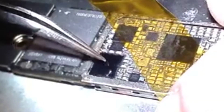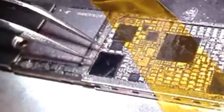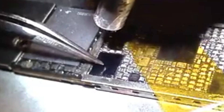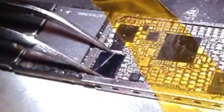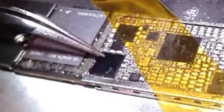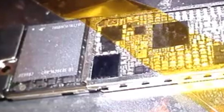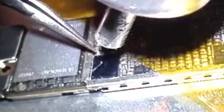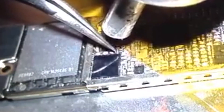That's the point where you can actually remove solder without melting your plastic FPC connectors, so that tends to be a nice middle point for us. If we're working around NAND or the Wi-Fi module, we're going to use something a little bit lower, somewhere around 280 to 287. Now that this hot air gun is heated up again, we're going to come in here and hold the chip where it's supposed to be and just heat it pretty liberally. With this board, you just have to get in and out of it — you can't hang around too long or you will blow the Qualcomm CPU. Unfortunately, we've done that on a phone or two, and that is not a fun conversation for you or your customer.